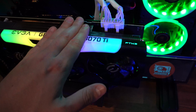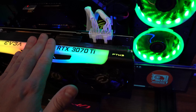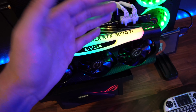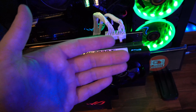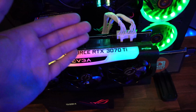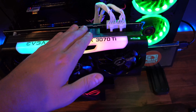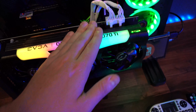I've had some instances where an overclock will fail, for instance, and MSI Afterburner will reset, or in the event that you have a mining rig that auto restarts from AC power loss or something like that, the rig might boot back up and not load your overclocks properly. But because you put a batch file on your startup, it'll start mining right away with no overclocks, which means it's going to be pulling full wattage from these cards. So I like to be extra safe when it comes to stuff like that.